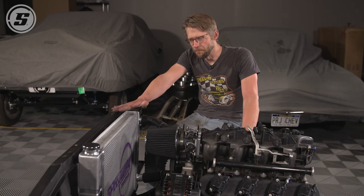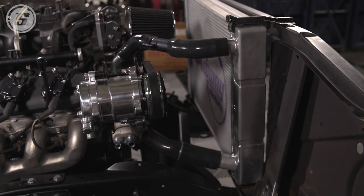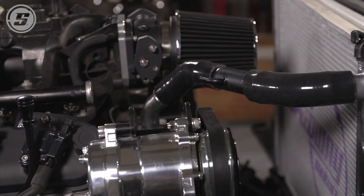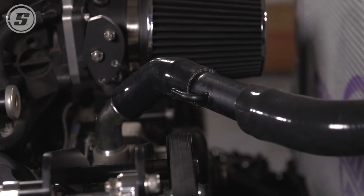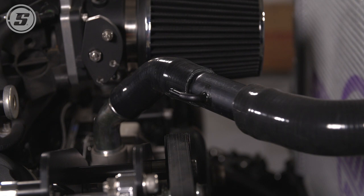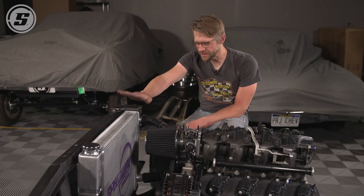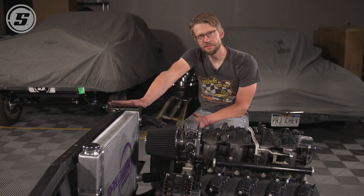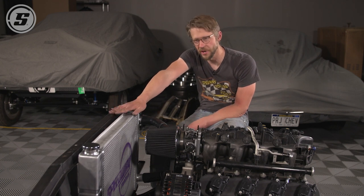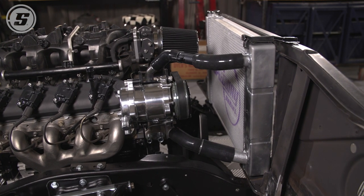That pretty much wraps up our mock-up on our C10 project. What we wanted to do was prove to ourselves that we had the right combination of adapters to make this universal radiator work, that it was going to fit in our core support, and get an idea of what fabrication would be needed for final assembly. When we get there we'll use hose clamps on all the hoses, hook up our steam lines, and install the dual fans on the radiator. A direct fit really makes this all easier and saves fabrication time, but the trade-off is the cost — so we're content to move forward with our budget-minded universal radiator. There's lots of information in the toolbox at speedwaymotors.com to help you out. Thanks for watching.